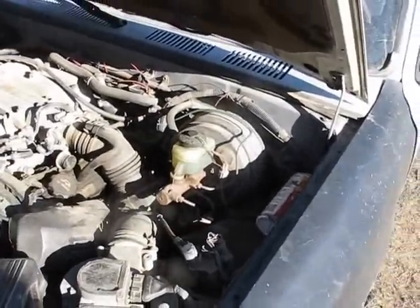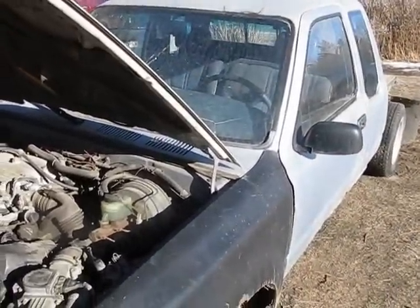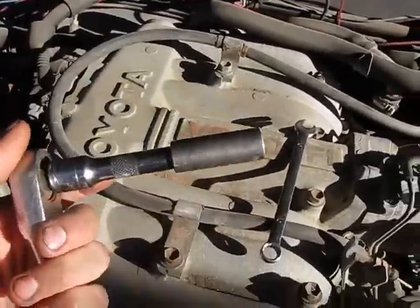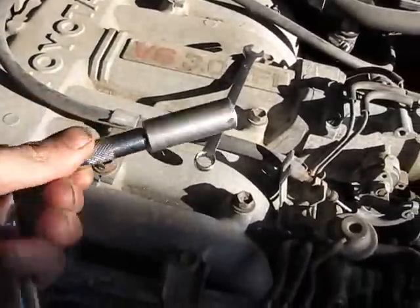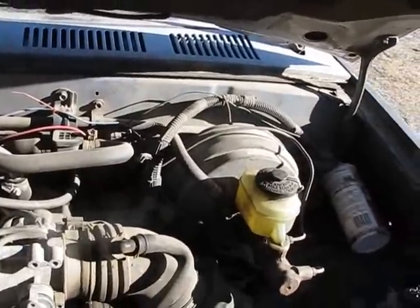The thing I like about these vehicles particularly is that you don't have to rip the dash out or the steering column out to do it. For your 12mm you're going to want a deep socket because the studs on the brake booster are pretty long.